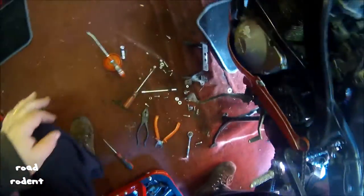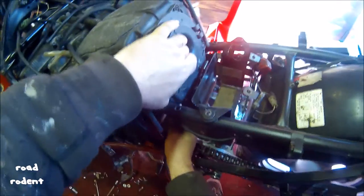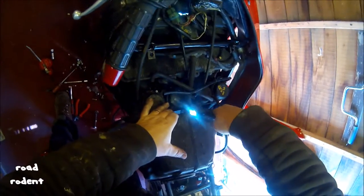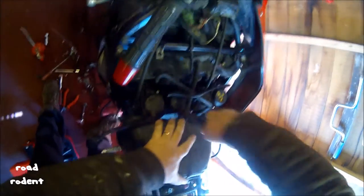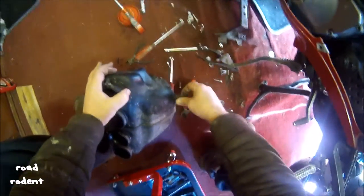And there's a bottom hose connected to it. Can we see it? There it is, look. Just pull the bottom hose off. Take the top hose off. Squeeze the clamp together. Break the seal. It should just come off the other end anyway. And just chuck it on the floor like so. Stick your pipe back on. You don't want to lose that, do you?